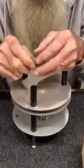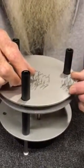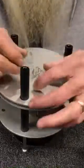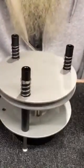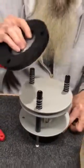Now your springs. You'll see on the springs, one end of them has a little bend. See that little key, that little bend? You see it, Barb? It goes against that plate, with the bent thing against the plate. Now once again, your nuts are in here.